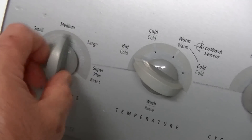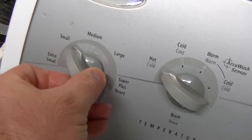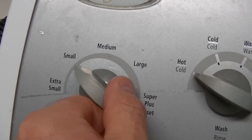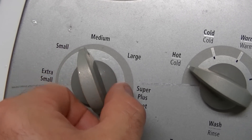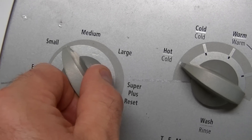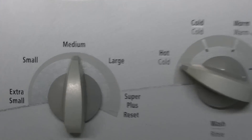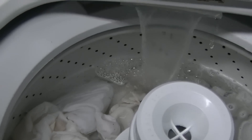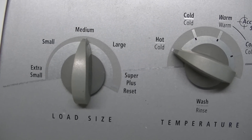You can go to whatever setting you want. As you keep resetting and the water fills up, the switch is going to keep going more and more to the right. You can keep testing it to see how it's operating the way you like. Now we're up to a small size load — getting more water each time. Resetting again going for a medium — there's our medium selected. The water level is about half right now. Let's get this medium size load in there — it should kick on any second, and there it goes.